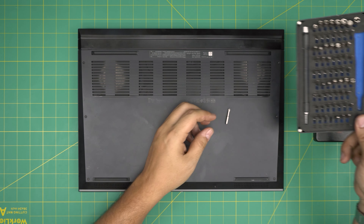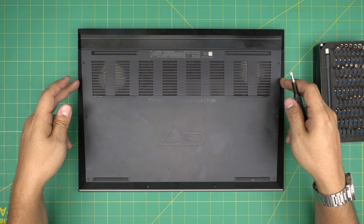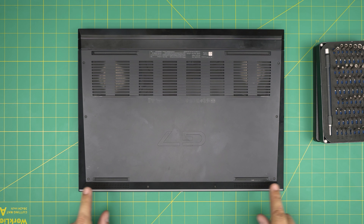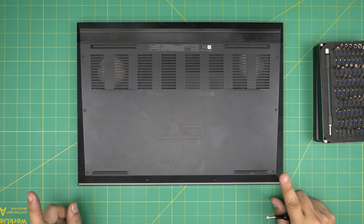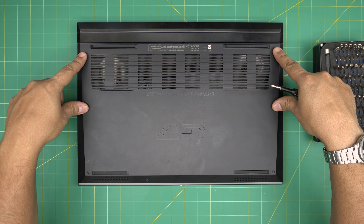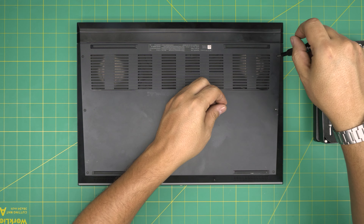On the bottom of the laptop you'll see a few screws all around: two on the sides, two in the middle, and one in each front corner. We are going to remove all the screws — they're all the same size and height except for the front corner screws. Don't touch those corner screws until the end. Go ahead and remove the two on the sides and two in the middle, and keep them together.